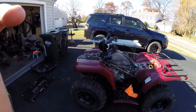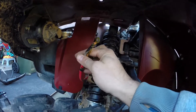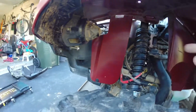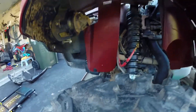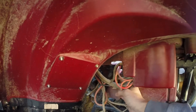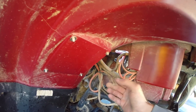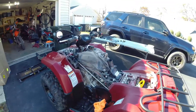Here I'll show you the pre-wired setup that Yamaha gives you. The wires are now exposed up front — you've got red and black leads zip-tied to the frame. Just cut the zip tie, unwind them, take off the coverings held on by electrical tape, and those are your leads for the front winch. Coming out of the rear, the terminals that hook up to your battery are back here as well — the negative and positive are covered in protective plastic coating, zip-tied, so just snip the zip and you can hook everything up when you're ready.